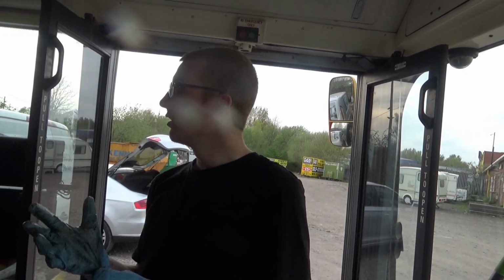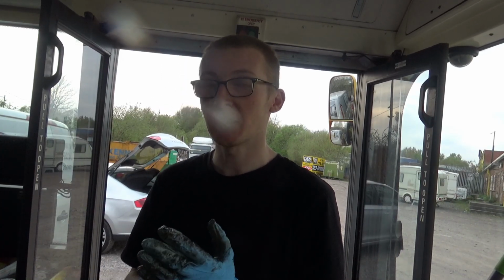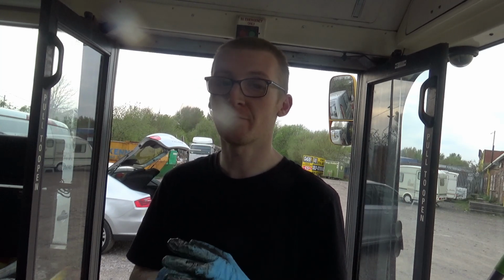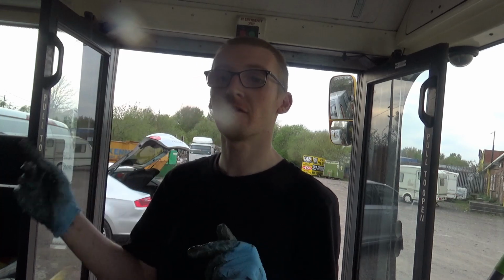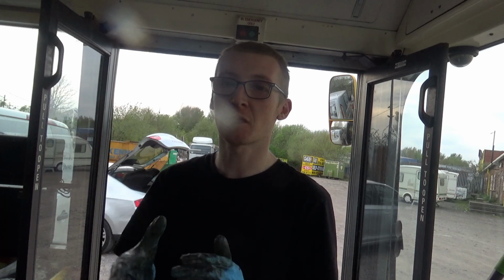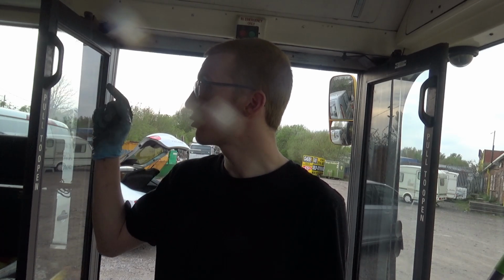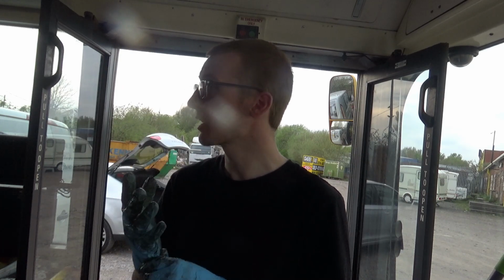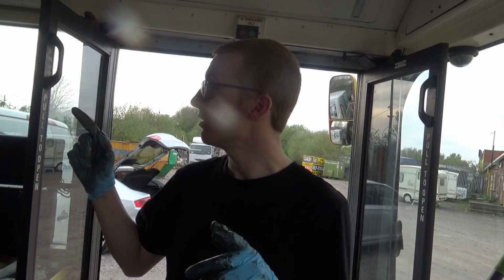Right then guys, so I know it's dark now. Well, you're looking at it, it's dark because of the backlight, but so with the now revelation that I can actually open these injectors, which is something we didn't think we were able to do because Sean had tried and failed. But where Sean tries and fails, I succeed. So we're going to get the other ones back off the lad who's got them. We're going to open them up, probably get a little kind of compressed air, spray them out, hopefully that will work. Redo the seals on them, pop them back in the engine, and then bleed it.